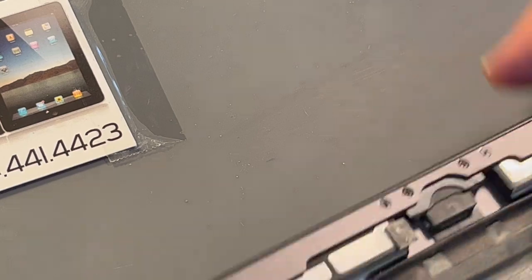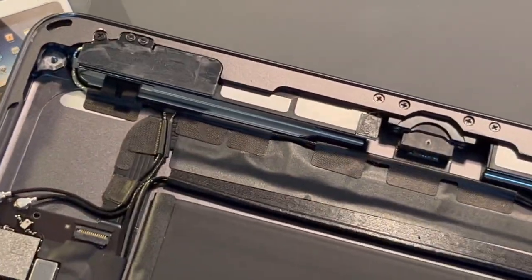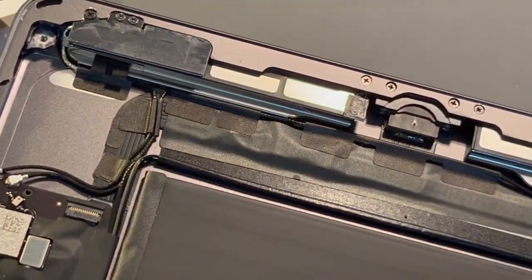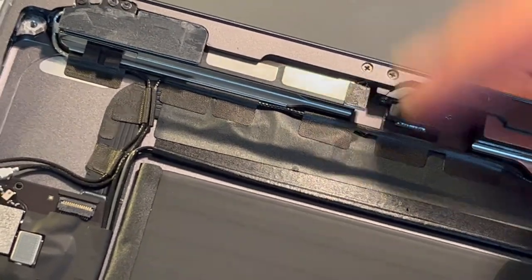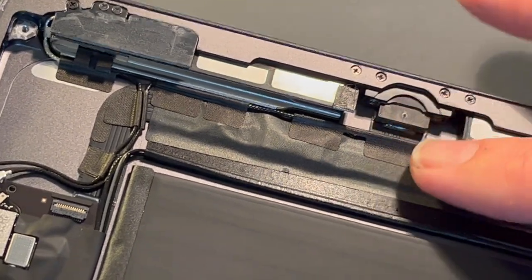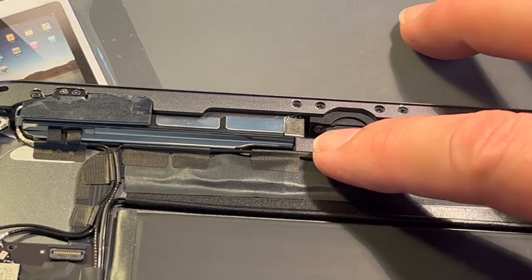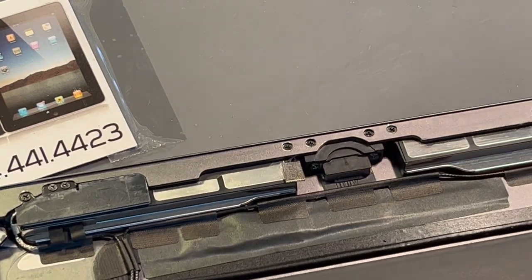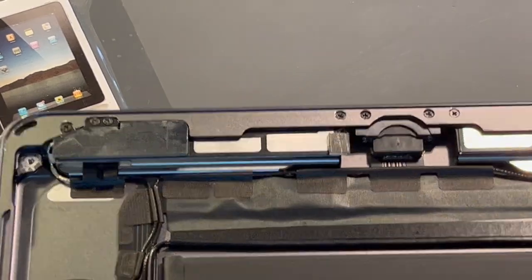If you're doing your own iPad, check these screws. Don't crank them super tight, but do snug them up. You can save yourself a failed charging port down the road by just taking that extra second while you've got the whole thing apart. I highly recommend it.